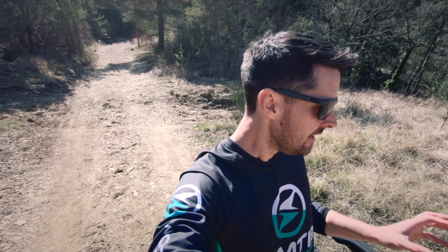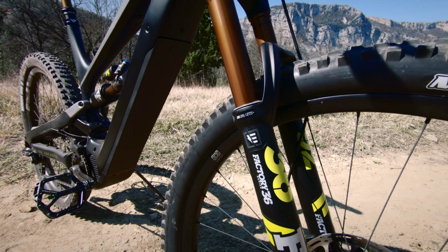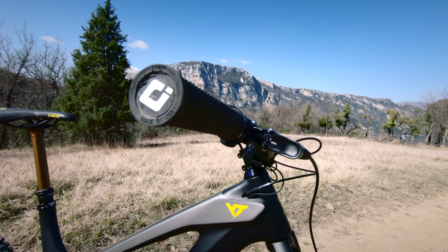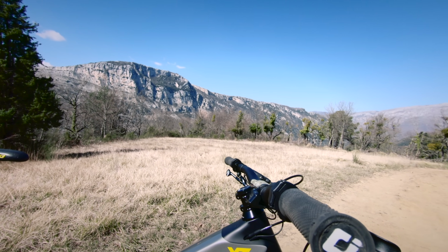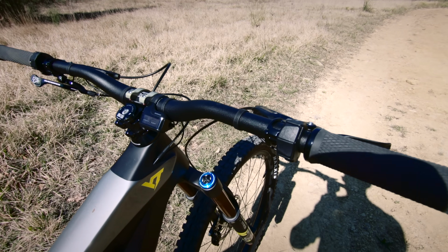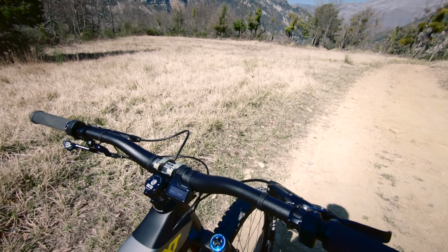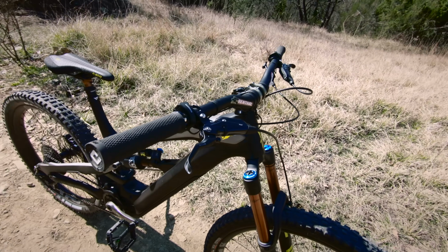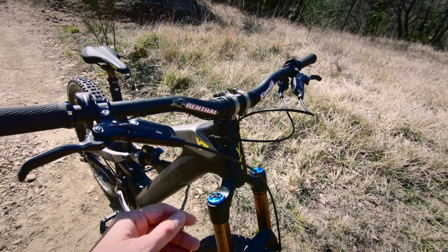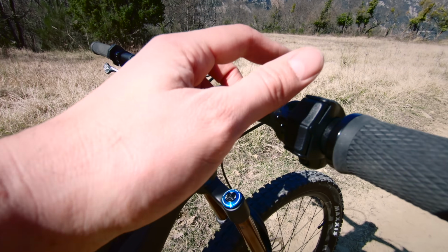that you would pick. Now this bike is 5,999, so if you think full carbon wheels, Fox 36, Renthal, the Shimano E8000 package, 540 watt-hour battery. That's a little bit more than most of the Shimano bikes that are out at the moment. What's really interesting about this is it's got DI2, so electronic shifting, and what that means is you can get a really, really neat look on the cockpit. Look, you can only really see 3 wires coming out. It's super, super clean, and it's got the newer E7000 shifter just here.